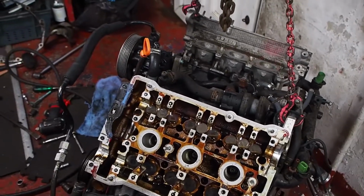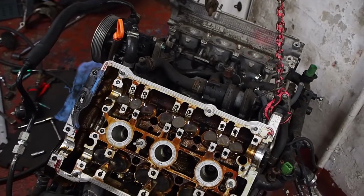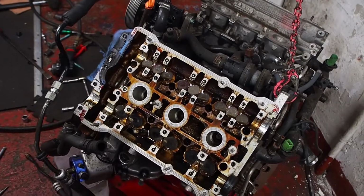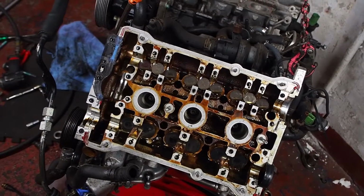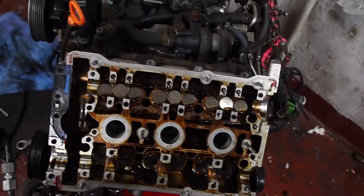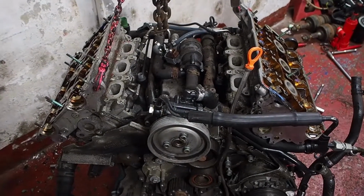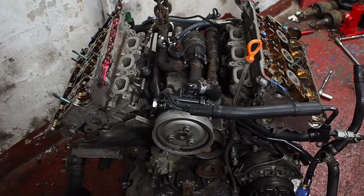I always was concerned the engine wasn't quite right. The EGTs didn't match up, and the wide bands are always slightly different bank to bank. So this might explain it if my cam timing was off because the tensioner was knackered. It drove fine. It wasn't like there was a glaring obvious problem. But I just had a nagging doubt it wasn't 100%, and the power result on the dyno kind of backed that up as well. So, good news.